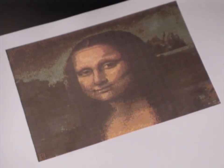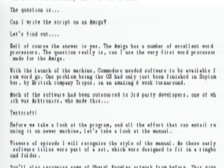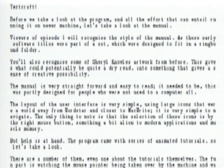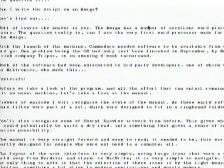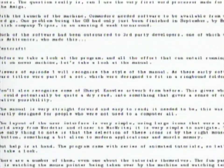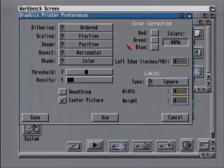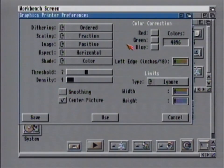If you're printing text, switching between 60 and 80 column text produces output many of us will be familiar with if you've ever had a dot matrix printer. As the Retro Printer is actually rendering the output based on the Amiga driver, it will be close to the quality produced on a real printer. A printer emulator, if you like. A more preferable method in this case would be to use the text capture mode, which allows for editable documents.